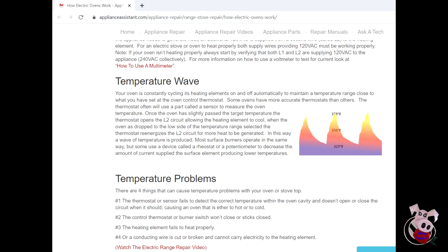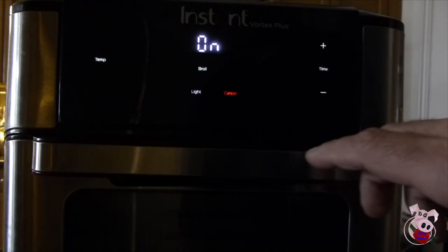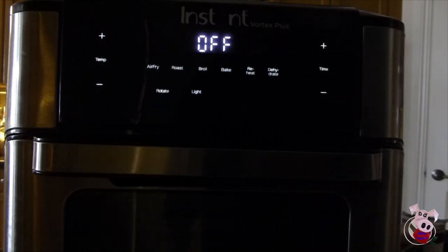I'll put a link to how an oven works, including a video on how to spot a hot spot. Going forward, make sure you give your unit the cool down time it needs after you turn it off. When you press the off button, you'll frequently hear the fan continue to run for several seconds to a minute. The unit is going through a cool down cycle — the element is still hot, so the temperature can continue to increase. The fan vents that air until the temperature starts to decrease and then turns off, ensuring it won't get overly hot and trip the thermal sensor.